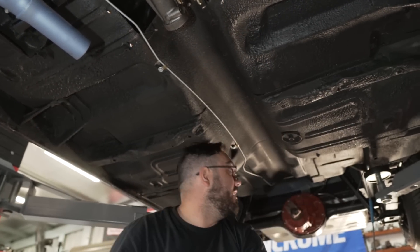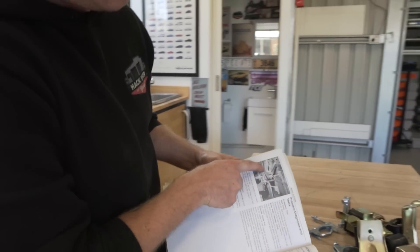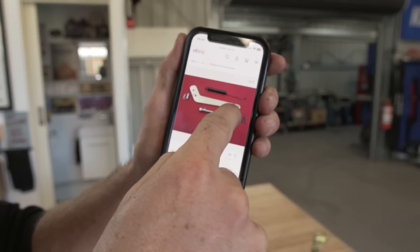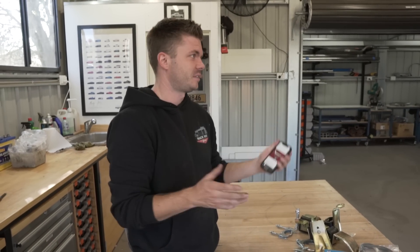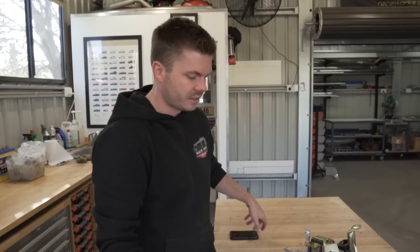I'll get the book out and see what we can find. I've had a look through our vintage workshop manual - you know it's vintage because the pages are falling out and yellowing. It looks like there's a handbrake equalizer; this is what the pull system from the dash goes down to - it's like a big lever arm which then transfers that to a U-thingy that the big loop cable goes to. We're missing that. Luckily there's a kit online you can get for it. This is like the handbrake lever arm where it all works its way through to the back. I'm not even mad because we can probably put that in after the exhaust anyway. I've passed it on to Rodney - Rodney, buy that please.